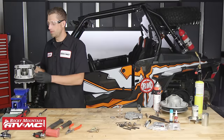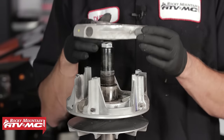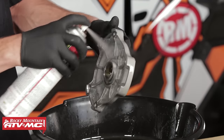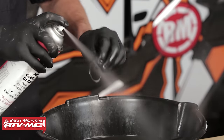We're back in the studio with the primary clutch's spider and spider nut removed. We're going to pull all the parts apart and lay them out in the order they were removed from the clutch. Once all the parts are laid out, we're going to spray them down with some contact cleaner, clean them all up, and then come back to service some of these components.